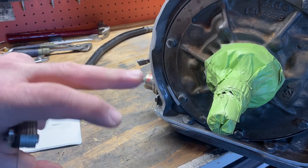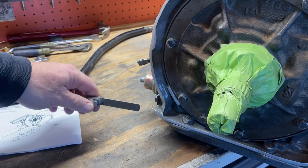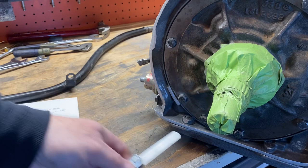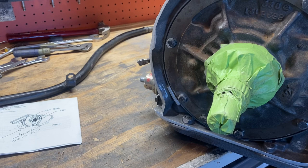This is something I learned from a friend of mine — Richard and David. When you try to bolt your bell on, I had six out of eight bolts in and couldn't get the other two. Something wasn't right. So you go around it with a feeler gauge and make sure — with the bell on — that you can run a feeler gauge all the way around. Sure enough, I had issues on the bottom and on one side. Verify you are not contacting any part of the original case, because if that ultra bell isn't 100% flat, you risk stripping the bolt holes out. This thing will leak horribly if it's not perfectly flat and all bolts aren't torqued to 18 foot-pounds.